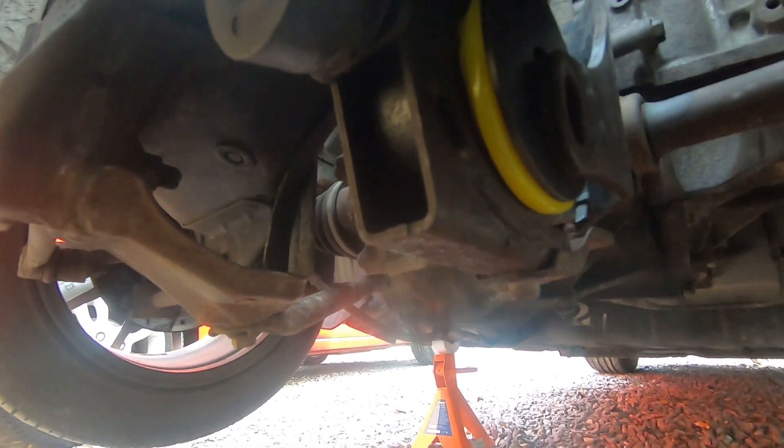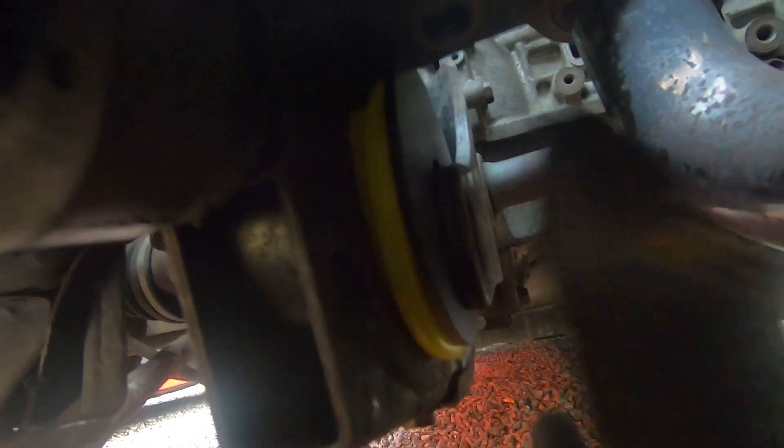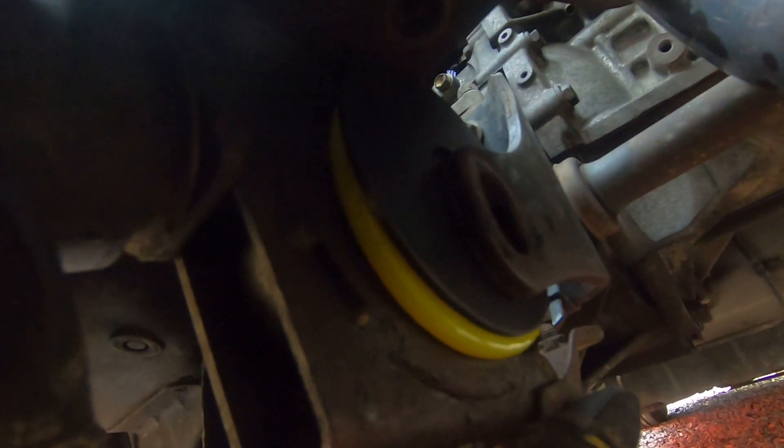A bit of a take two for this one. What I tried to do originally was bolt the four 14mm bolts up to the car without the washers in place. However, your mileage may vary depending on the condition of your rubber bushes. Where mine doesn't quite fit there are gaps, which is just down to the shape of my rubber - every car is going to be different. With those four bolts in place I couldn't get these two black washers around. So I've dropped the mount back out - it comes in and out nice and easily now. It does just take a good amount of wiggling to get the washers and the four bolts to all line up nicely, because the motor mount is offset slightly and the motor itself has moved. I've been jacking the motor up and down using this strong cross-bar either side.